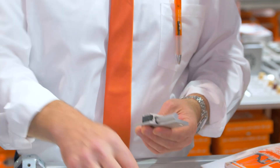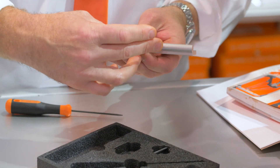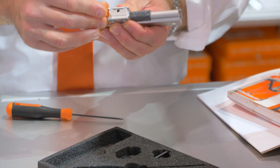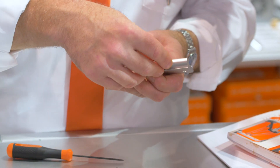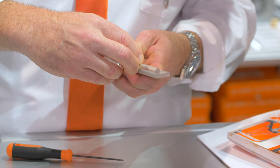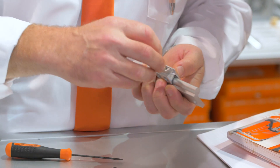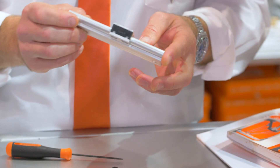It works like this: you take a small flat head screwdriver and pop out the locking feature, then use a very small tool to push the old liner out, take it off, press the new liner on, push it back into the housing, then pop it all together using the tool — and now you've changed your bearing liner in under 30 seconds.